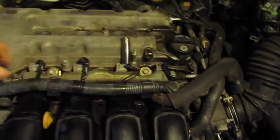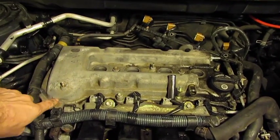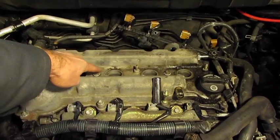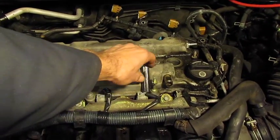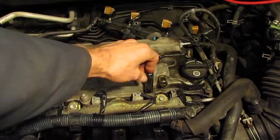There's a series of bolts on the outside of the valve cover, all 10mm. Two 10mm nuts, one here and here, two 10mm bolts in the center of the valve cover, and then depending on the trim of your engine there's a 12mm stud here that holds the plastic trim piece on.